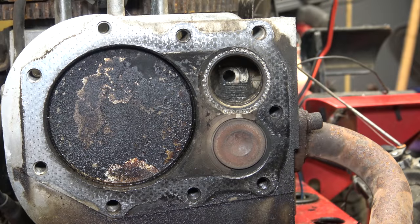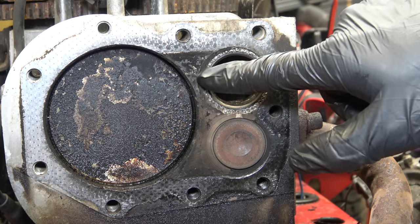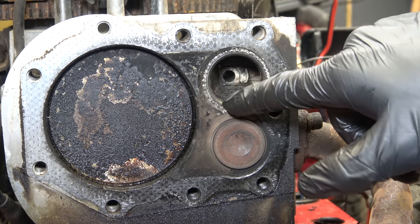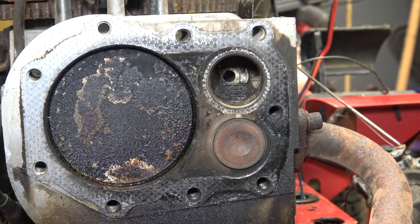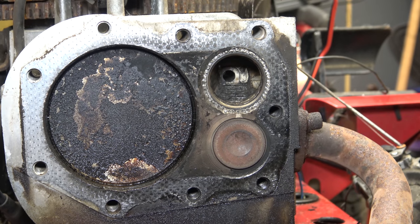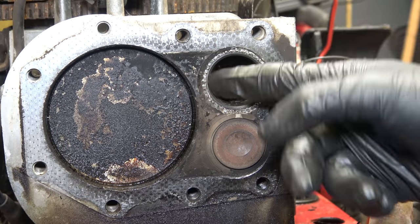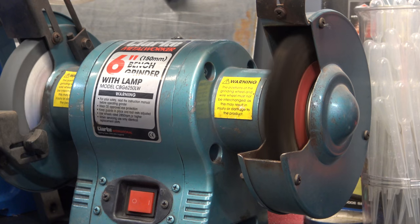Okay, that should be all right. The only time I've seen another failure is when uneven pressure is put on it. So say you're doing quite a bit of punching here and not much here or nothing here. You'll put uneven pressure on the seat itself and it'll probably fracture. But yeah, when I've seen it done like this, there's never usually a problem. But it was already so well in there, it probably wouldn't have moved anyway, but it's just like an extra precaution.